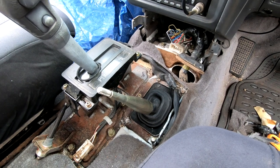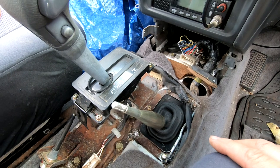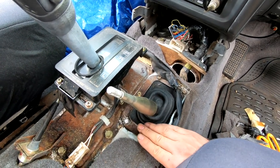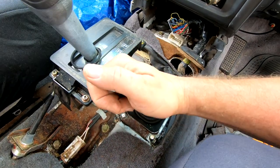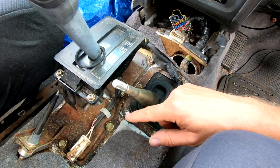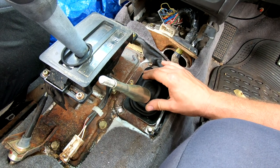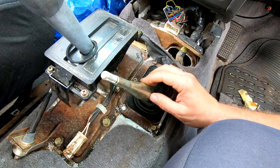We'll address the transfer lever while we're here. The manual gearbox is not such an issue, but the transfer on a manual is on that side. The problem with body lift is this bit here is coming higher, and what can happen is where your center console is you cannot get two wheel drive — sometimes you have to notch the console out. I'm going to pull this rubber boot out and lift it out of the way so that once we've done the body lift we can address exactly what we need to do here.